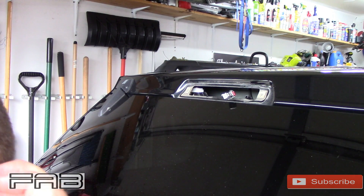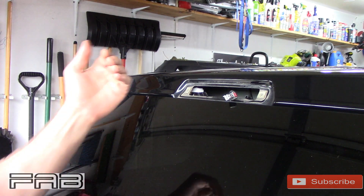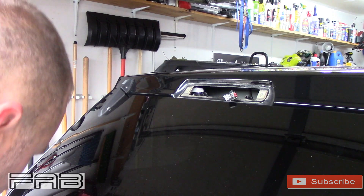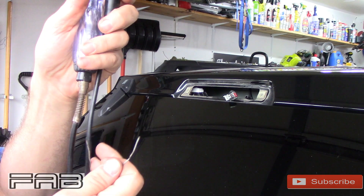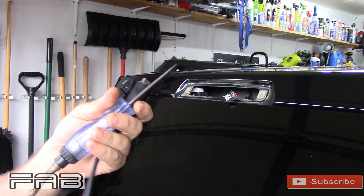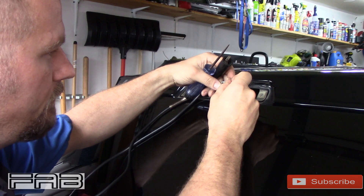So this is the easiest way to test whether you're testing a light, a window motor, a blower motor, a wiper motor — anything that's a two wire connection with a power coming in and a constant ground. All you need is a paper clip. You can buy a test light like this one for about ten bucks or so at Harbor Freight, AutoZone, or something like that.